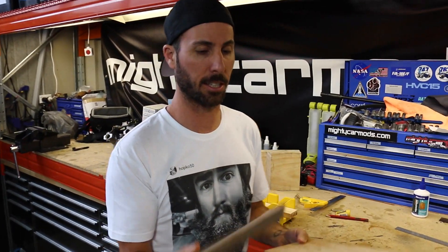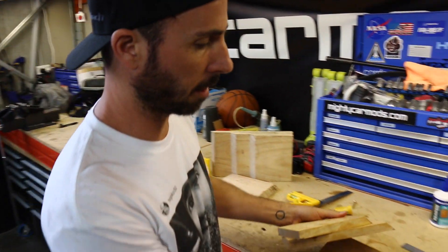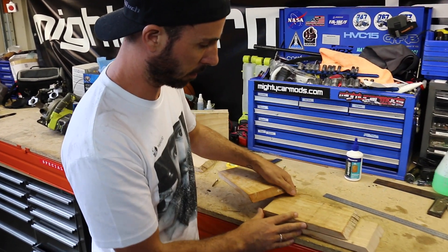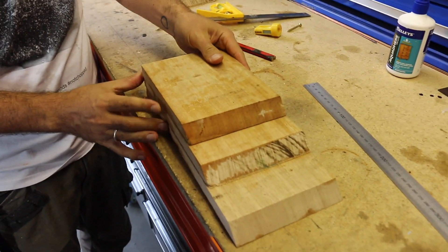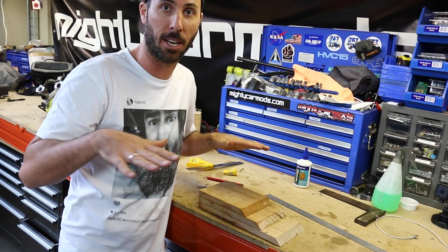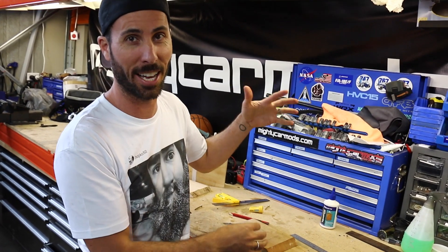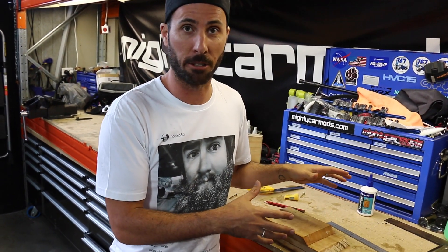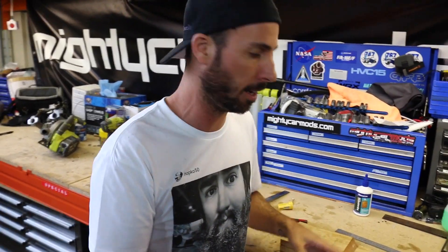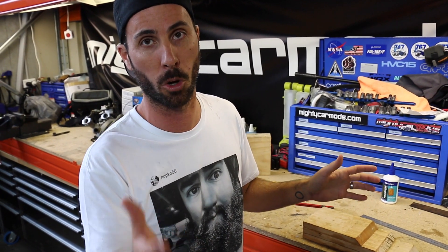When you're cutting on an angle, it actually gives you two pieces when you flip that one over. So for your last cut, all you want to do is just cut straight down. Now that you've got your three pieces, you can lay them out — obviously the longest one on the bottom, this one on top, and this one here. Depending on how low your car is and how hectic the bumper is on your Honda, you might need to make this one a little bit longer so your car can gradually rise. You can also stack these and make them longer depending on how high your car needs to be. I also want to reiterate: this is not something you use to actually work on your car. This is literally just to get the ramps under your car so you can lift it up, then put your jack stands under there and work with them as you normally would.